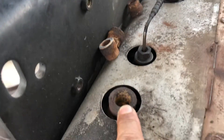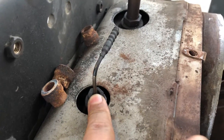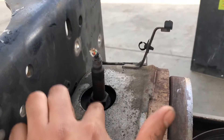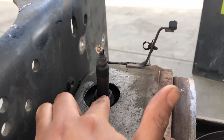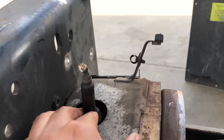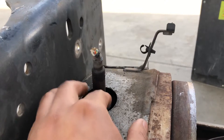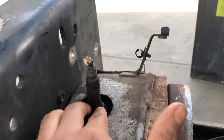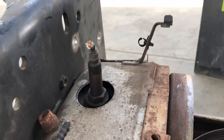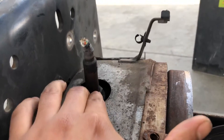This fitting here is for the DPF outlet pressure sensor, and this is the DPF outlet temperature sensor. One of the main things drivers complain about is the NOX sensor — this is the inlet one. Many drivers ask why NOX sensors break so often. It might be defective parts from Freightliner — I'm not sure. We change this sensor out a lot of times. Freightliner won't warranty them because they are electrical parts.